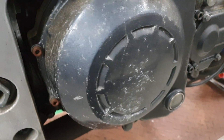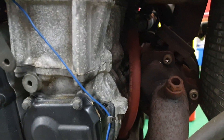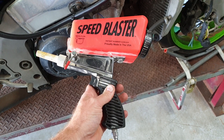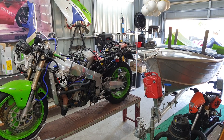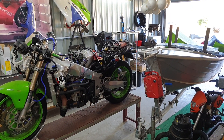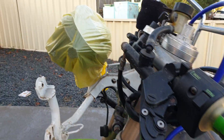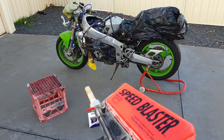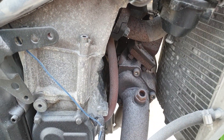This stuff that needs to be painted obviously, but all this ferrous sort of stuff we'll give a quick blast — mainly the head, barrels, and crank cases, and might even give the turbo a bit of a blast too. Here's the little gravity-fed sandblaster I've been using. It's been a while — might need some more air. Let's push the boat out, drag the bike off the bench, do some blasting. I've wrapped all the electronics up in plastic, the air filter and the gauges.